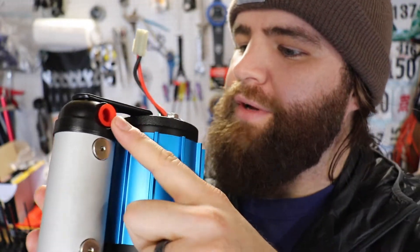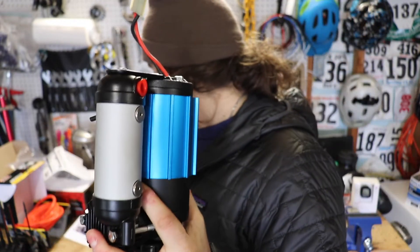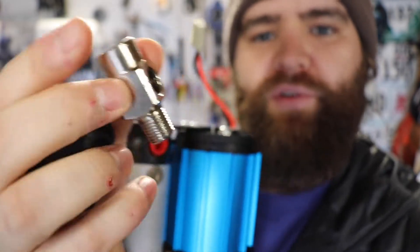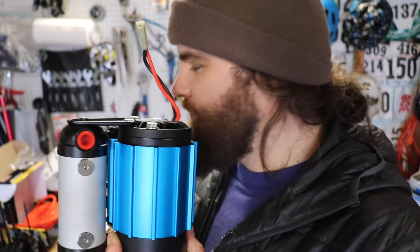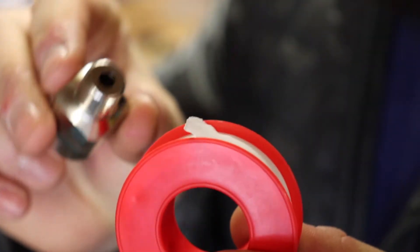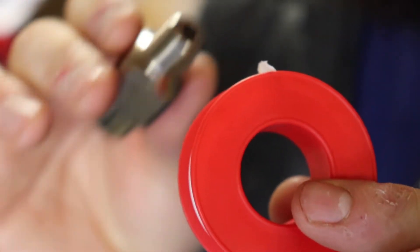It's another day. I'm going to try to install the compressor today as well as wire it up. I had to go to Home Depot and grab some Teflon tape for the different fittings. Here's the compressor. We're going to pull off the little red cap and put some Teflon tape around a T-fitting that came with the ARB air-up kit. It's a T-connector so you can put your compressor shutoff switch in one end as well as the air chuck in the other. Always use Teflon tape on your air fittings — it'll make it airtight. No need to really torque down on these, but make sure you use Teflon tape for all your fittings or you'll have air leaks.